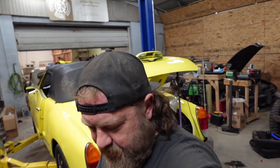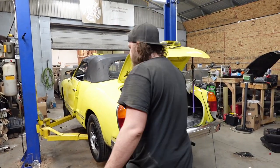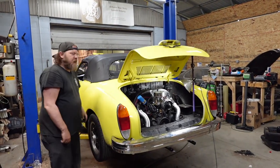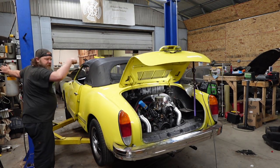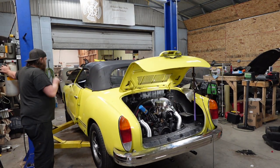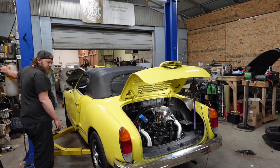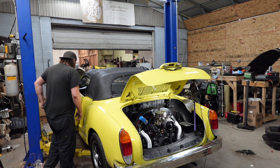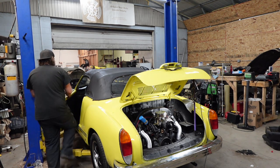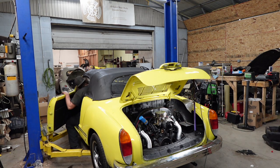All right, if you can believe it, installation error. The rubber line or clutch guide tube, the soft one, I had it routed. It was bent weird around the transmission. Took away any slack, slop, either or that I had. All right, let's try this. See how she runs. Well, not how she runs, but we'll see how she shifts.